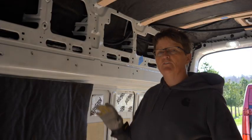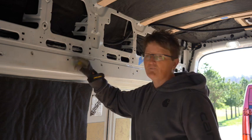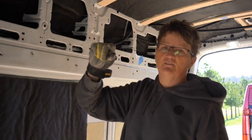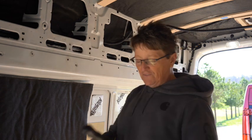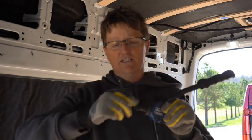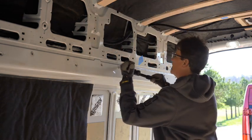All right, guys, if you got the Ford Transit and you are putting the riv nuts in, these holes that are manufacturer are 6 mil, and when you put the 6 mils in, they just are easy to strip. They're easy to overforce. I feel like if you go with the 8 mil, it's harder to strip, and you don't have to worry about over muscling it.